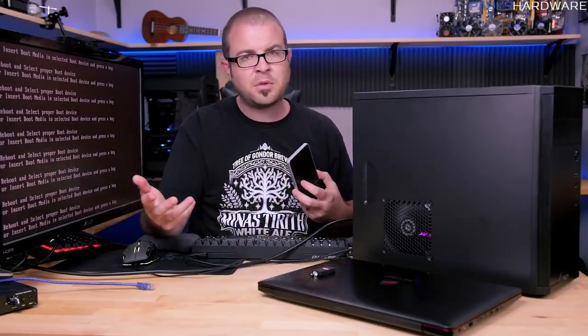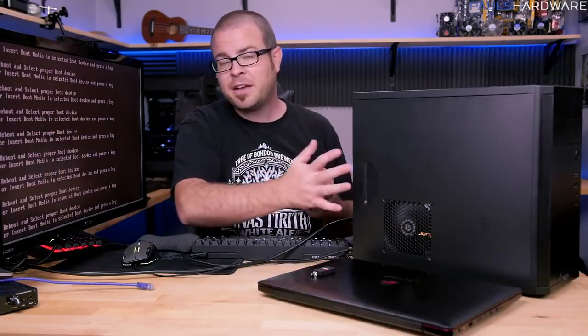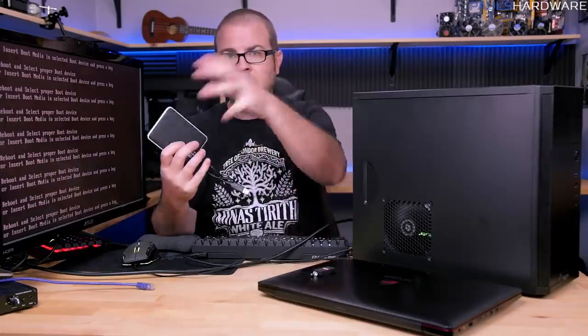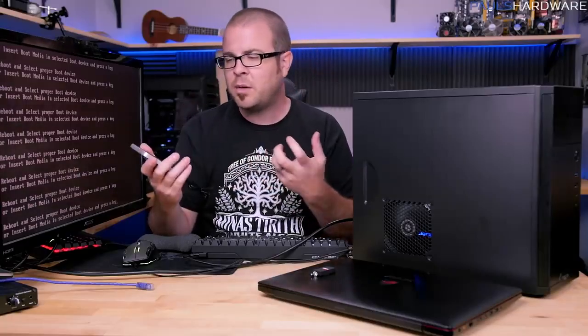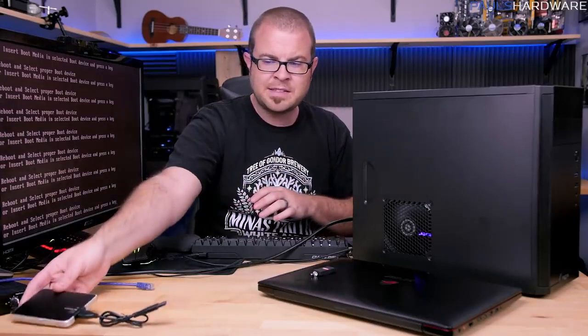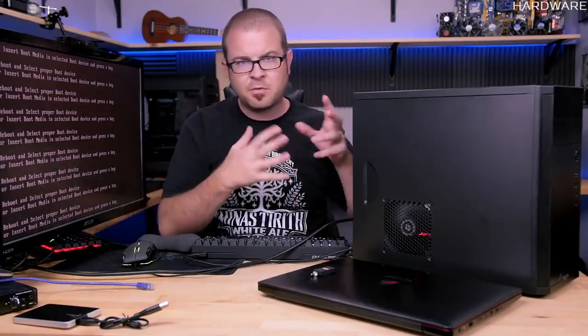Finally, and this is just a fair warning to any of you guys who are actually using this as a tutorial for upgrading a system or installing Windows on a system that might have data on there already: get an external drive, something that you can plug into the system while it's working, and copy everything onto it. Again, there's nothing to copy off of this one right now since it's brand new, but make sure that if you have any personal information, pictures, My Documents, anything that's irreplaceable that you can't re-download from the web, like basic program installers and stuff, get that onto an external drive, unplug it, set it aside, and that way you'll know that even if something terrible goes wrong, you will still have your data